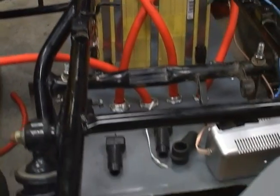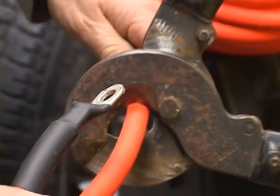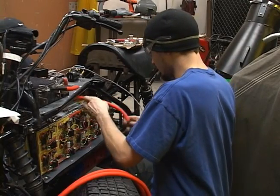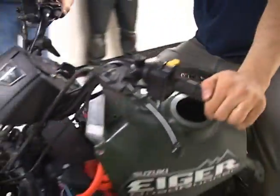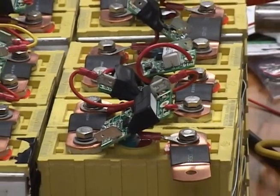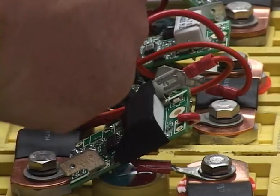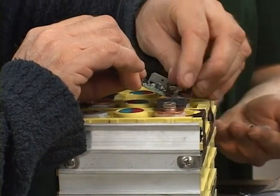Then it's a bunch of electrical wiring. The circuit consists of several items — most importantly, a thick copper wire. You take your battery pack, connect a positive and negative wire to your DC controller. The vehicle can also go in reverse, so we're using a reversing contactor that swaps the wiring on the motor to enable reverse. That completes the high-voltage wiring. The battery pack consists of 16 lithium iron phosphate batteries.